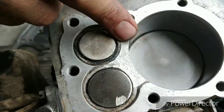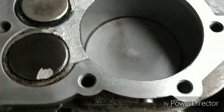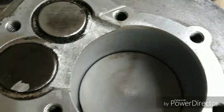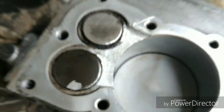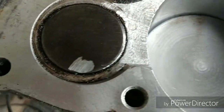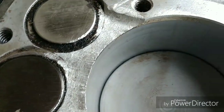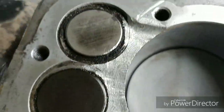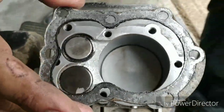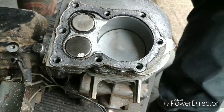We are done here with shaving the eyebrows out. You can see the difference — not the smoothest, but it'll work good enough for who it's for. We kind of nicked the valve a little bit, but it'll be fine. Nicked the surface here a little bit, but there again it'll be fine. It's a stock motor other than this little bit, so we're gonna reuse the original head gasket — it's not too bad.